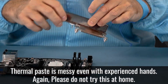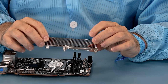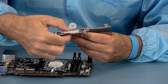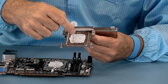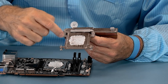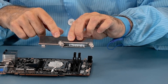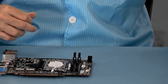And lots of thermal paste. Here is the cooling solution — a nice copper fin array with a vapor chamber. The vapor chamber works: you can see that this is actually a cavity. This is a vapor chamber like a heat pipe, except this entire plate is a heat pipe. So any hot spot is immediately transferred to the entire surface area, which includes the fin array area, which wicks that heat up the fins, and the blower blows it out.